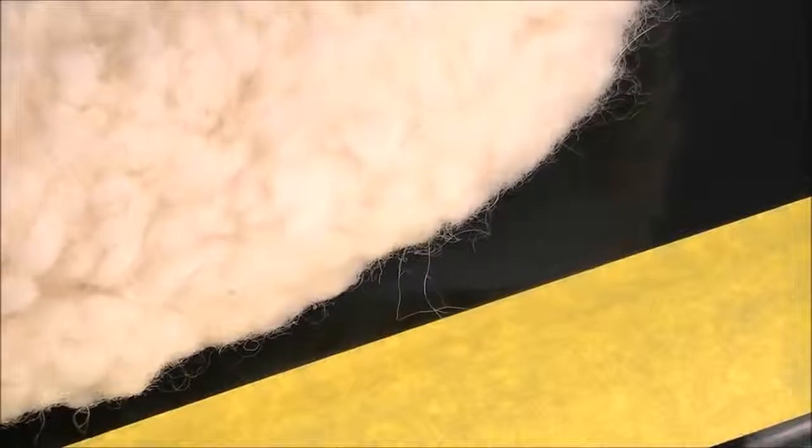Okay, so to take care of that haze, first thing I got here is the rubbing compound. I'm going to use a wool pad. I've taped that edge off there just to kind of protect that edge so I don't burn through with the polisher. Try and set it around somewhere between 1500 and 2000 RPM.